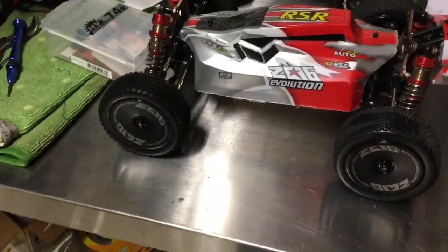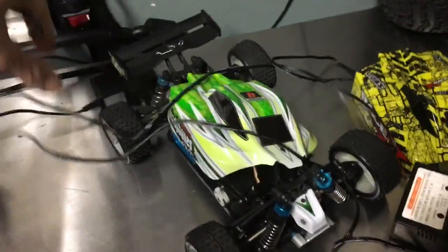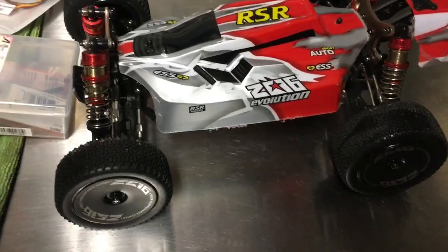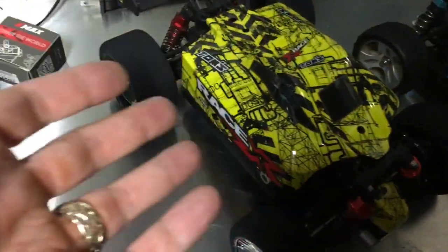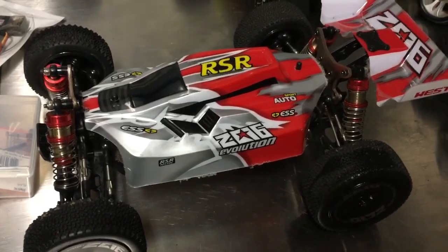I love the car as it is. A lot of people will say, why upgrade? Why even mess with it? Why not just leave it alone? And honestly, I probably should leave it alone. But I've had such good experiences with the other upgrades I did on this car — it's just an amazing thing to drive these things when they're brushless and have that much power. You can control the amount of power that you have, but you don't have to use all of it. On this car, for example, I can barely go past half throttle. This car actually has the chassis, the ground clearance, the tire size, the suspension — everything to handle the type of power that comes with a 4,300 KV motor on 3S.